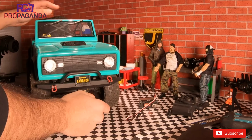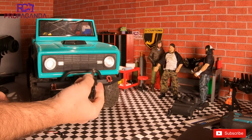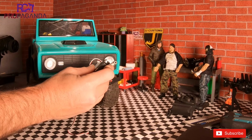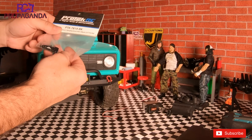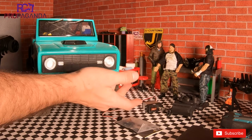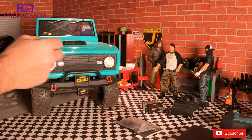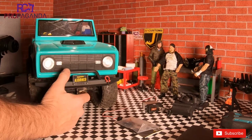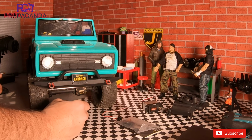All right, guys, so just to wrap it up real quick, don't forget you're going to need a different servo horn. Most common servos have the 25 tooth spline, so you won't be able to reuse that horn, so make sure you pick a servo horn up. I'm not sure what ones will work. That Pitbull one I put on there worked fine, no problems. If you can, get one of these program cards, turn your voltage up to take advantage of your more powerful servos, and yeah, nothing came up odd or anything like that. Rather simple, so there you have it.